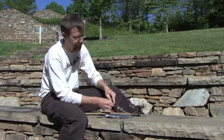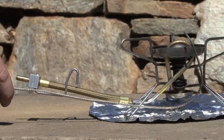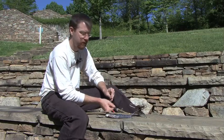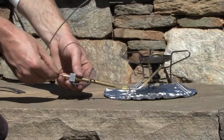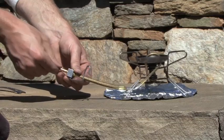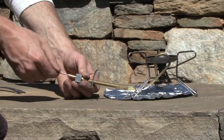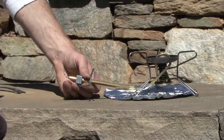The reason I'm setting it like this is so you can see that this cable is bent like our fuel line, and that's the easiest way for it to be assembled back into the stove. This cleaning process can take about five to ten minutes and it's something that you need to do maybe every three to four years. Think of it as a tune-up that you give your car — this is your tune-up for your stove.